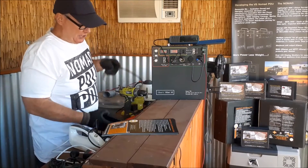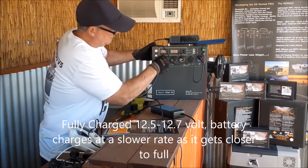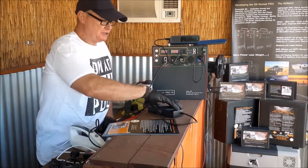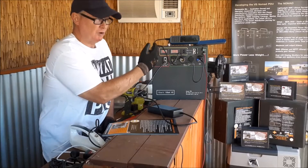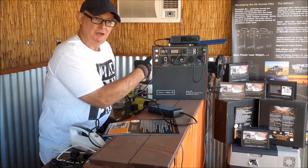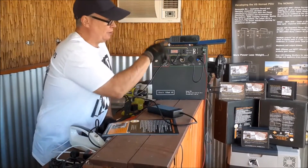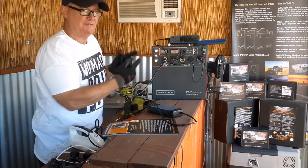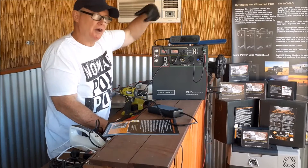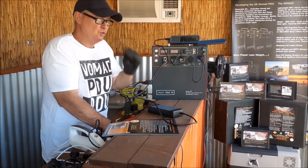The little charge light on here tells you when it's charging. It does come with an AC-DC charger, which is an 8 amp charger. When you plug this in, as the battery gets closer to full it will draw less current. So sometimes if it's at 12.4 or 12.5 volts and you're pulling three or four amps out of it, the red light will go off and people think there's a fault — it's not a fault. The charge from this unit will run the accessories, and whatever's left will top up the battery.